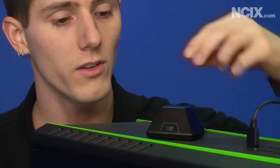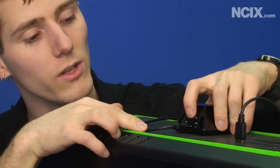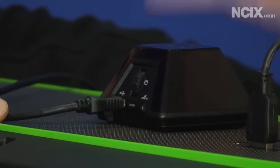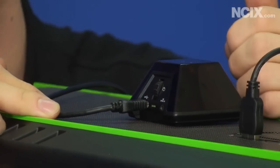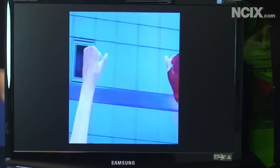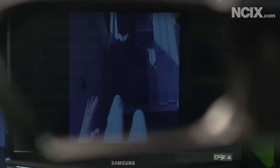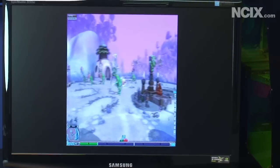The IR emitter looks like a little brick. It needs line of sight to the glasses. On the back there's a wheel for controlling how much 3D depth you're comfortable with — a lot of people start at very little depth and work their way up. There's also a 3D sync input for 3D ready TVs; some DLP 120 Hz TVs are already 3D ready. On the NVIDIA demo reel you can see two images superimposed for the left and right eye — here in Mirror's Edge, holding one lens over shows it goes from blurry to only the right eye image, because the glasses are blocking every other frame. Make sure your infrared emitter has a clear line of sight to the glasses' receiver.